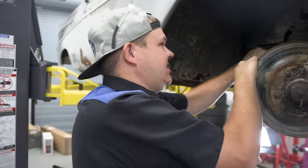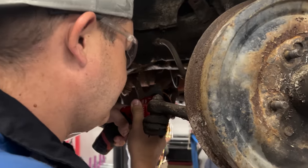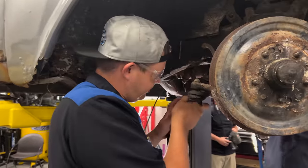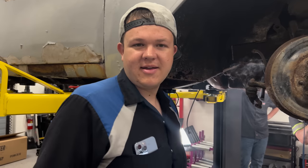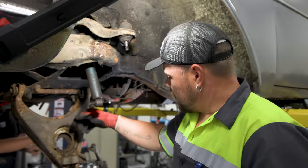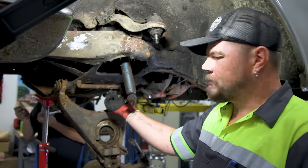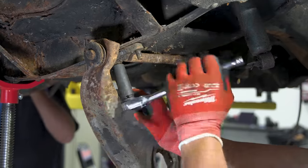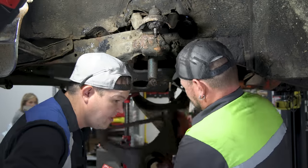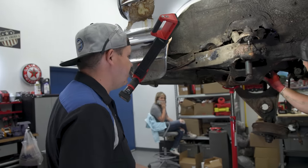Hillbilly's working on that side, so I decided to start on the passenger side. We're just going to drop as much of this suspension out as we can. We got the shock all released and the coil spring out. Now it's going to be safe to pull these four bolts to drop the lower control arm out, which in turn means the whole spindle assembly and lower control arm will all just fall on the ground. One side's done - I've got the coil out of the other side.